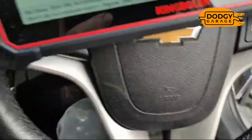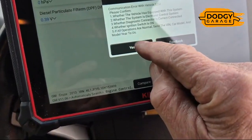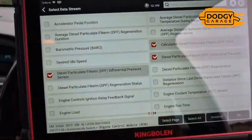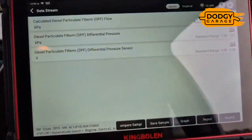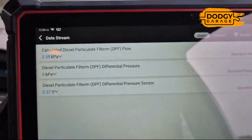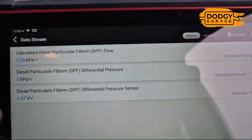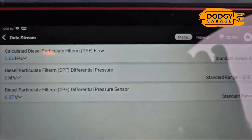I've already been in and loaded up the diagnostic tool. Going into the system, we want exhaust after-treatment information. We're looking for differential pressure — you can see it there. We're looking for anywhere between 0 and 10 millibars, which we've changed to HPA — HPA and millibars are the same thing. I've already started this car and at idle the HPA was at 30, which is obviously quite blocked.